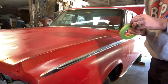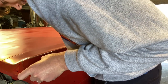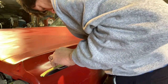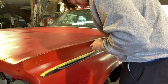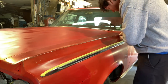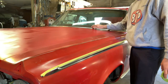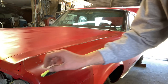It really does look pretty flat, so I'll do some sanding. Let me preface by saying if there's a chance at all that my sander will touch this trim, it's getting taped off. But I'm going to hand sand probably this entire area of the fender here just to be sure there's no mistakes. Not that the stuff is that difficult to take off and polish, but if I was going to take it off to polish it, I would take it off before I paint it. So I think my plan for today will be sand from here all the way to the opposite side, tops of the fenders. I'll probably leave the cowl alone, and I might go ahead and do the bottom of the fenders to see where I get to.